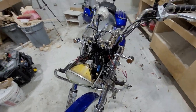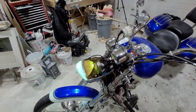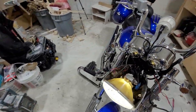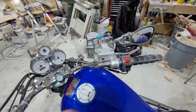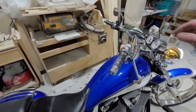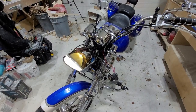I've got the other side installed now. There's no resistor on this side at all; there is a resistor on the right side at the back. Well, I got a hyper flash but it's working. I have hyper flash all around - hazards, everything works. Just got to figure out how many resistors I need. On a good note, I didn't burn out that ACM module, so I'm in business. I just need to finish up and get the hyper flash removed.